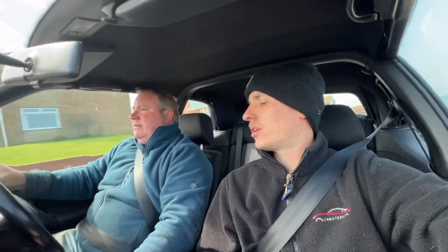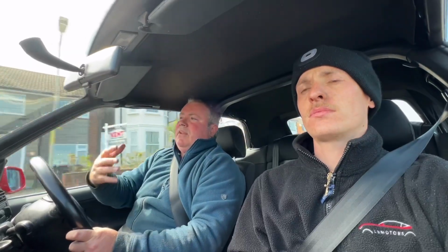Yeah. Obviously, all the vacuum lines are now where they need to be. You'll see in one of the videos that it kept coming up with a pending code that the vacuum pressure was wrong, and in the airbox there's a vacuum flap that opens up to let all the air into the airbox for a cold start, then it shuts it half down. Well, somewhere along the line somebody has swapped those vacuum lines and they were wrong, so instead of closing or opening the flap, it was doing the opposite of what the ECU was telling it to do.